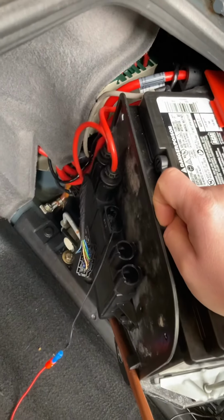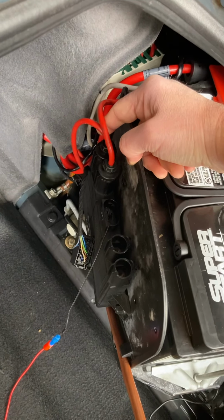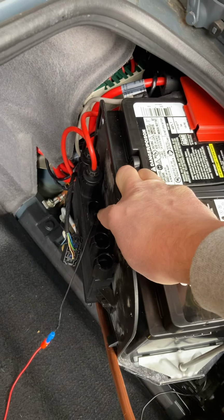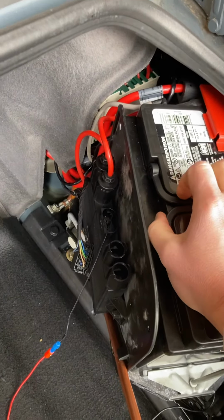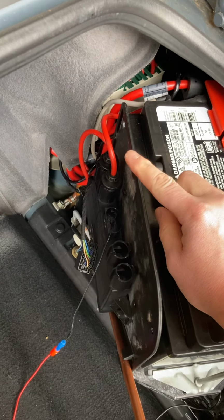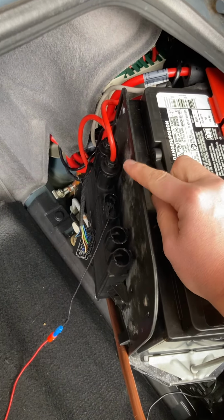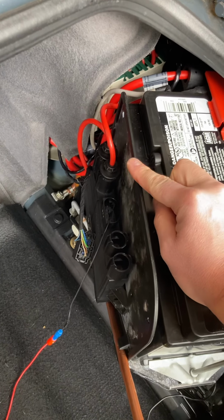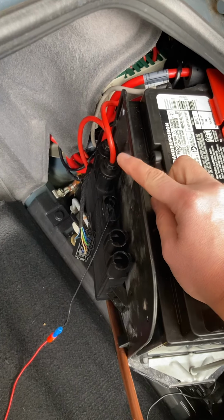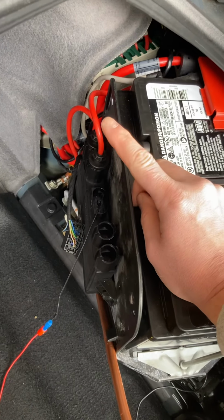To me, that's a little odd because these cables right here run directly to the batteries themselves. That would indicate that the pin 4 voltage signal that's being sent directly to the EKat module is all of that. So if there's anything wrong with the components in the EKat module, in the grounding circuitry or whatnot, you're going to get full juice from the batteries themselves running right through that circuit, which doesn't seem correct to me.